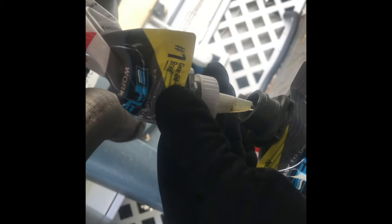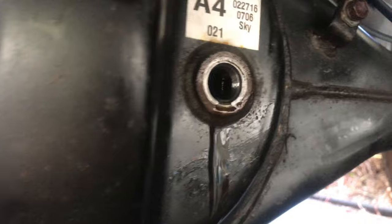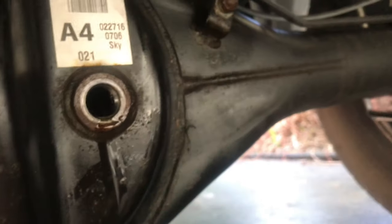I got a new pack. Pulled the protective strip off. I'm just draining the old pack into the new pack to get as much in so I don't waste any. I'm going to reuse the same cap on the new bag. I put about three and a half of those flex bags in — so about 3.6 quarts, which I think is what it takes. Double check on that. Once it starts flowing out of the fill tube, give it a few minutes and put a little more in. Once you know it's flowing out, you're filled up. Go ahead and tighten these down and torque them both to 36 foot-pounds.